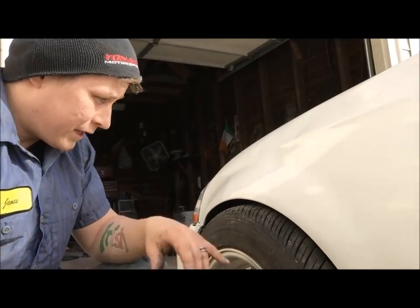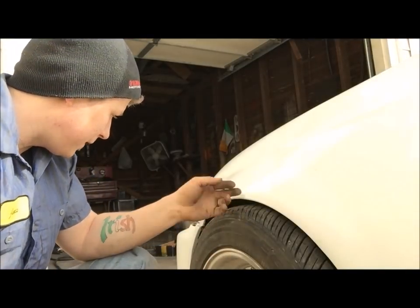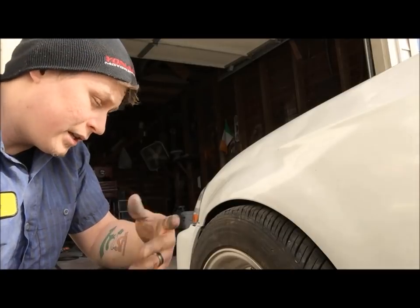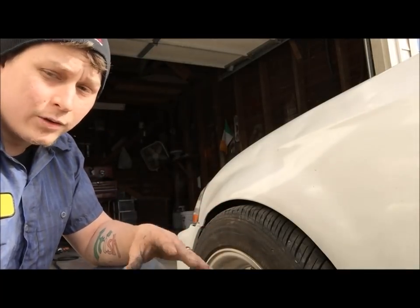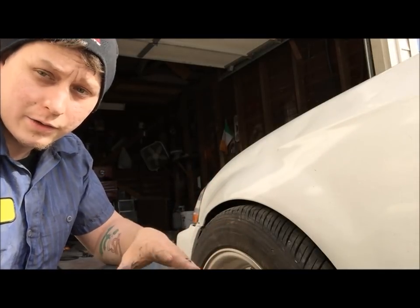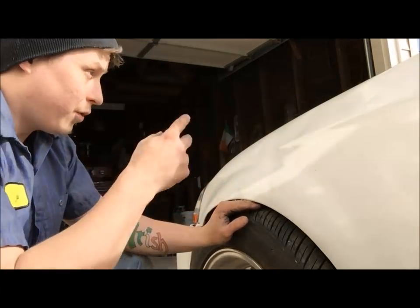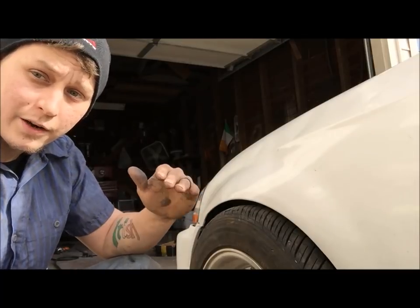It does have a little bit of a gap, but it might still not be enough just because I'm going to rub fender a lot. And a lot of people's solution is just to roll the fender. These fenders are crappy. I don't care if they're rolled or not. But the back, I don't like rolling because it's a possibility to make it rust and crack and so on and so forth. So what I'm just going to do is I'm going to do all four of them, make sure they're all four done, and see where it sits, and then try to go from there.